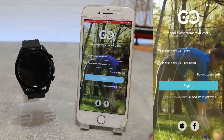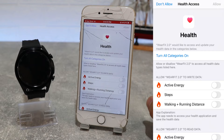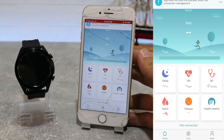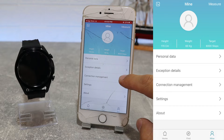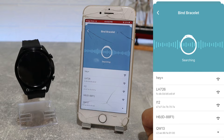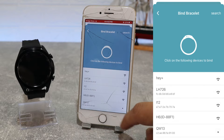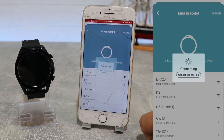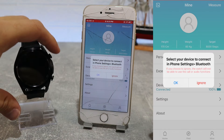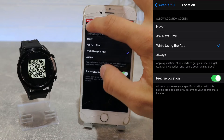In the beginning you'll need to open an account or connect it with a third party, however it's convenient for you. After it is opened it will ask for all your health access. Now we are ready to use the app — here we have 3 pages that we can use. On the last page we have to go to the connection management, press search and keep the watch close. After just a few seconds of searching you can see how it found the watch immediately. Click the i12 and wait until it says connected. After you click the i12 it shows a page to confirm connecting to it. Now that it's connected the watch will synchronize itself with the phone. Don't forget to connect it in the Bluetooth page too so all the options can work properly.